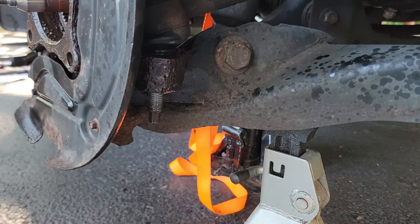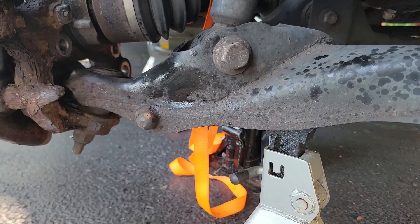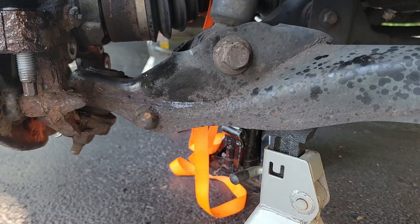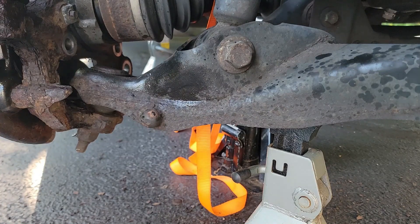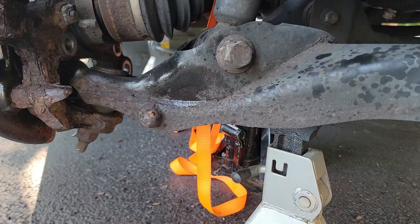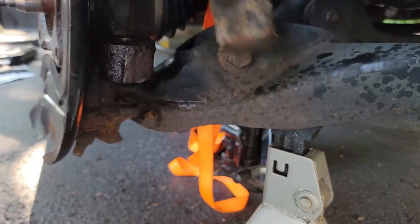So I'm going to try something that you should never do — I'm going to turn my truck on and turn the steering wheel from side to side in hopes of breaking the tie rod free. You can see right away how dangerous this is. Look how my truck rocks on the jack stand. I did not notice it while sitting in my truck, but after seeing the footage I won't be doing that again. Instead, you can see me hitting this part of the hub, which separated it perfectly. I would advise you do that and do not move the steering wheel back and forth while it's on jack stands, unless the whole front end is lifted in the air. This allows the hub assembly to move freely side to side, which is beneficial if you need to remove the CV axle or the integrated wheel end, otherwise known as IWE. Now just give it a couple of whacks and the tie rod is completely free.